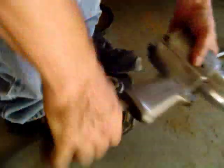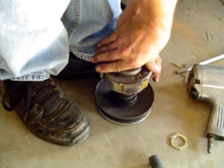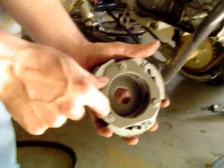Just that much is all it takes. Do the rest by hand. Notice I have not let off yet because if you do, this thing's going to come shooting off. Nice and easy — pull them off there. Now if you were to be replacing the clutch arm springs as well, they are actually sitting in here.